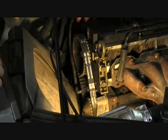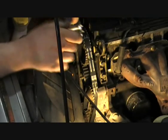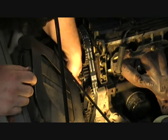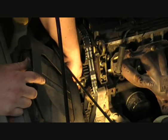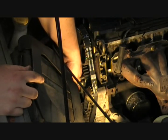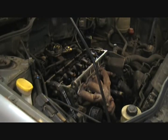That's the belt on, so just going to check that it's definitely lined up with all the marks. It's extremely awkward to do this because I have to pull the tension on it and tighten the nut at the same time. But you can see that's the action there that gives the tension on the belt by pulling the special tool around. So I just have to tighten up that nut while I'm doing this, but it is very difficult to do. Right, I'll just give it a turn now by hand, just with a ratchet. Belt is on and tensioned and the rocker shaft is secured down.